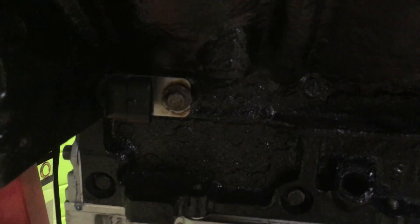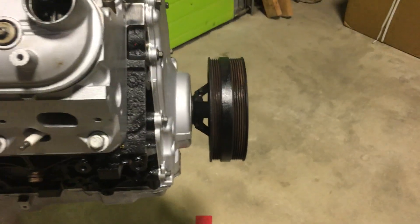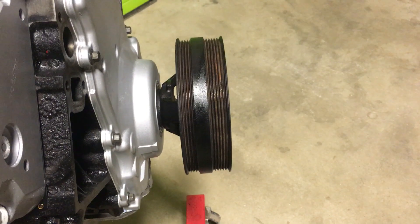If you can see that little dark area in through there, that is your crank sensor. This is a truck harmonic balancer, which means truck spacing. That can be taken off — you can use car spacing.